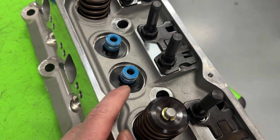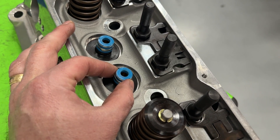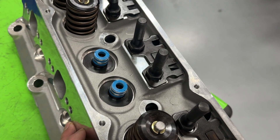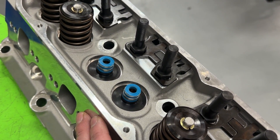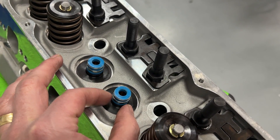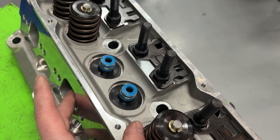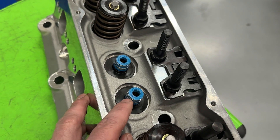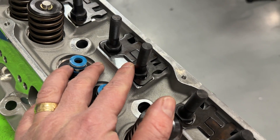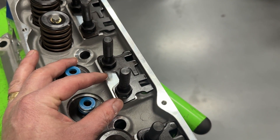Because they use locators, that's not an issue. These seals are very easy to remove. The ones they'd used previously had a steel cladding with no rubber on the inside — they were the worst to take off, I'm talking like 40 minutes taking off the seals. The ones with steel on the outside but rubber on the inside are easier to take off, and that's typically what I use. Nice ID locators — awesome. You might notice 7/16 studs — this is an upgrade, runs about $20-25 more to go from 3/8 to 7/16.